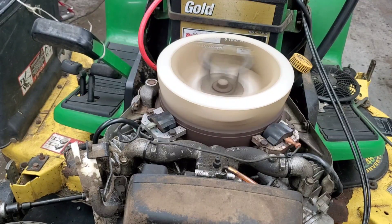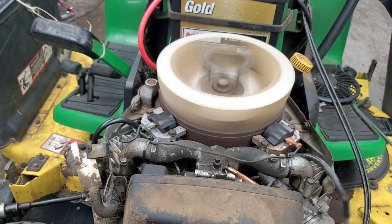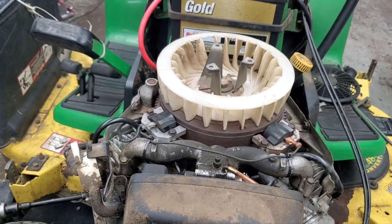You can tell just right off the bat — it's running a lot better, a lot smoother. You can hear the power out of it. We're going to go ahead and test the cylinder on this side independently to make sure it's actually running. We're going to disconnect this one like we did before, but we expect it obviously to stay running. And there we go — running on that left side that we were testing before that obviously wasn't working because the coil wire was completely chewed, and so was the ground wire. Honestly kind of surprised the thing ran at all at that point.